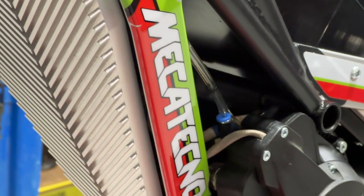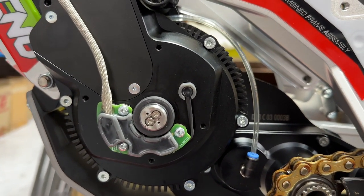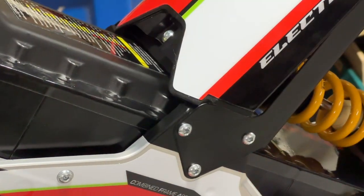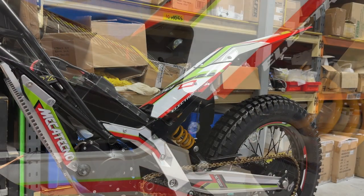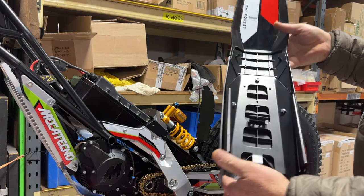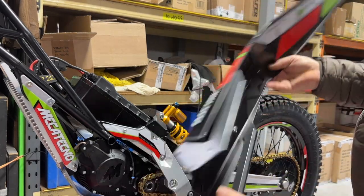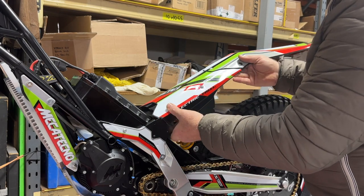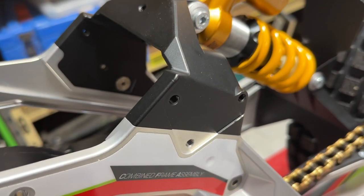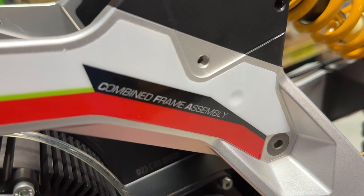The side panels are made from 7075 T6 alloy. With the side plate cover off the motor you can see the crank sensor on the electric motor and all the fittings. The frame uses combined technology with a chrome-moly top frame and alloy side frame. The subframe comes off very easily — just three screws each side — and slots in nicely over the Ohlins rear shock, held in by M6 screws.